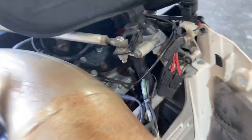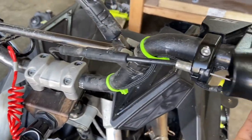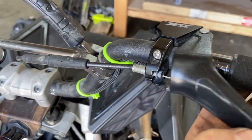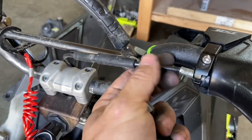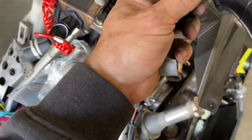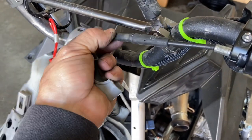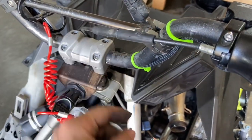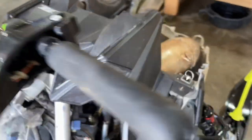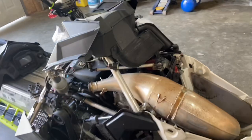The old ones here, you can tell they were pretty much shot. Anyway, up next we'll replace that one, and then we're probably going to go right on to running the new throttle cable, because this one definitely has some burrs in it. I was running into issues last winter of the cable not wanting to retract into the sleeve — kinked and messed up in places. I'll keep the old one for a spare in case I get in a pickle, but a new throttle cable and finger throttle are going on. First up, last steering bushing.